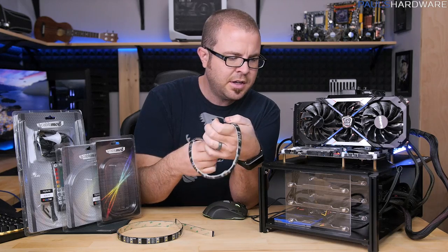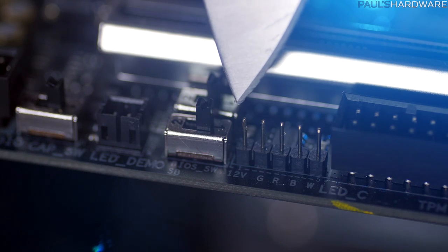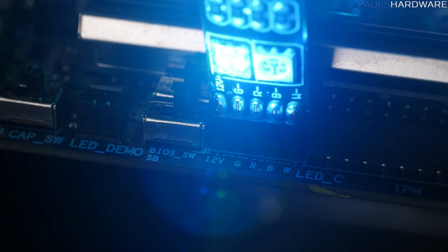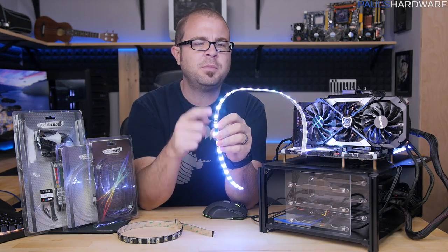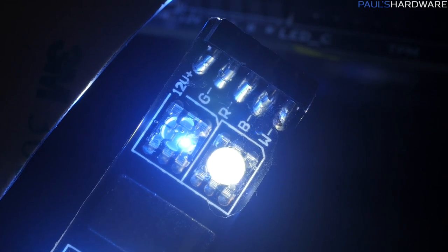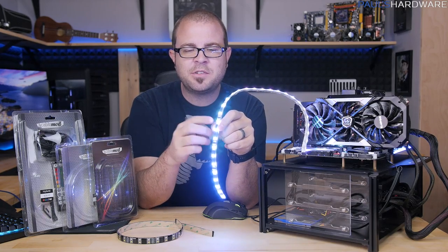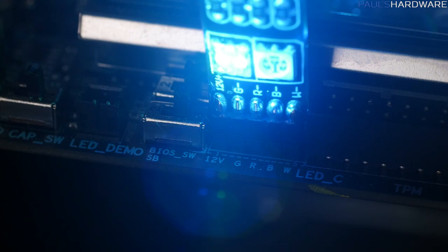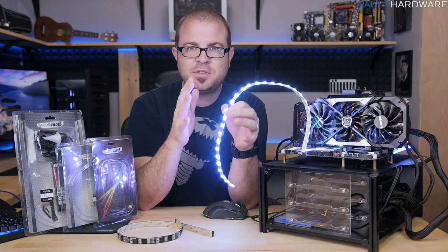Let me plug this one in right here. You have a 12-volt connection, and LEDs can operate on either 12 volts or 5 volts, so double-check — most motherboards that have headers, like this Gigabyte Z170X Gaming 7 or Aorus Z170X Gaming 7, have the pinouts labeled and use a 12-volt connection. Some kits you might buy off eBay could be 5 volts, so do double-check that. Each light on this strip is referred to as a 5050 LED, referring to the size: 5mm by 5mm. Each light has three diodes within it, and each diode receives a signal coming down the cable — that's why there are three other pins besides the 12-volt power — and those three connections tell each diode how bright to be.